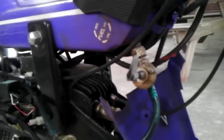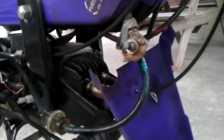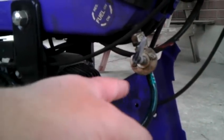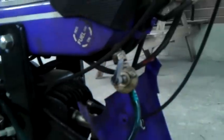This is a '96 — it was bought new. I bought it from the previous owner, who was the original owner. They kind of left it outside and obviously now the inside of the tank is not in the best condition, so some of the debris clogged up the petcock valve. Before that though, I obviously changed out the fuel line, cleaned out the carburetor. And this fuel filter should catch any debris that comes past the petcock.